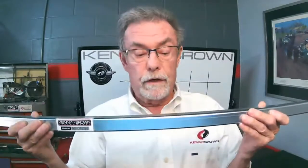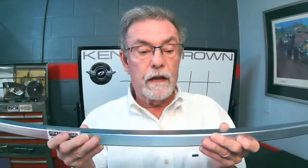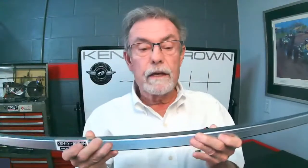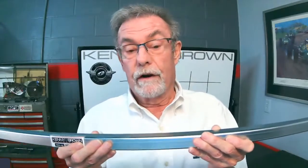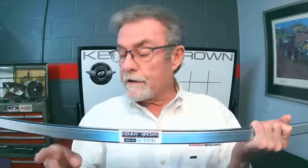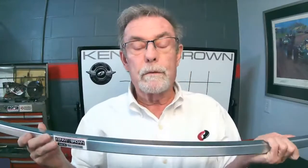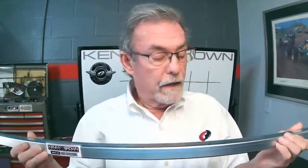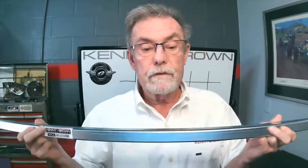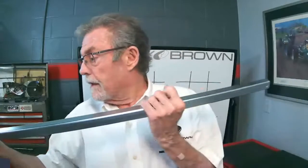I mean, it welds right to the pinch weld. And back in '86, when we first did this, the SCCA declared this as an illegal chassis stiffening device. It made no sense. We had a full cage in there, so I actually had to take a hacksaw and put just a little bitty groove, 2 grooves, so it wouldn't be considered a continual piece. In '87, they didn't mention anything about it. But this is a jacking rail for the Fox. Also, it fits the S197 and it fits Gen 1 Mustangs.